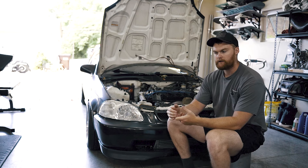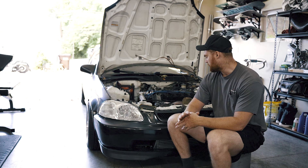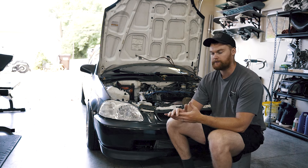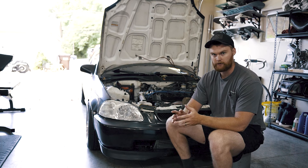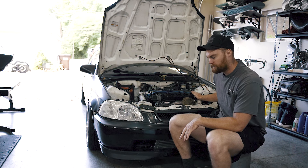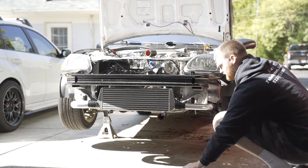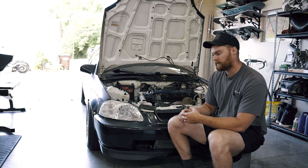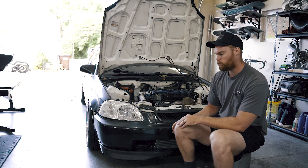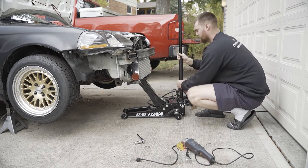In this video I just wanted to explain and talk through how to turbo your Honda Civic — not going balls to the wall — stock motor, and this might be a surprise, stock ECU. Speaking of stock ECU, I have never once had an issue with this being untuned. It's only on about five to seven pounds of boost, which I control with just a five-pound wastegate spring. Let me pull up a little parts list here.